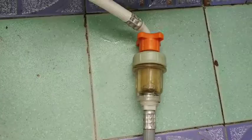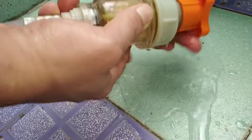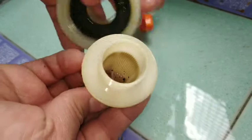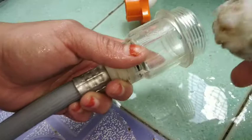I also clean the water filter that is attached to the inlet pipe in the washing machine — it can be easily opened and cleaned. Many washing machines are different, but nowadays all of them do provide this filter. This is just to reduce the effects of hard water on the appliance, so cleaning it thoroughly with some soapy water or even a tissue paper is advisable once a month, or at least once in three months.